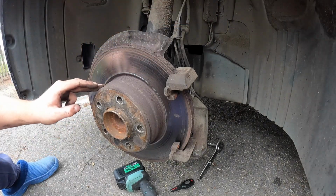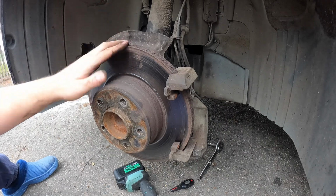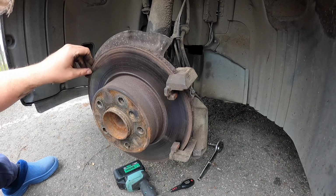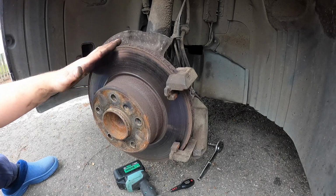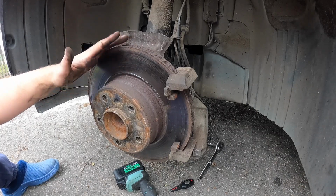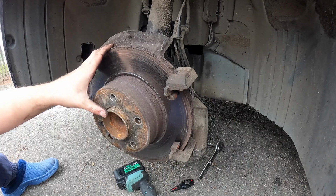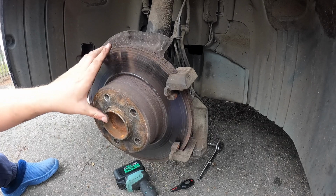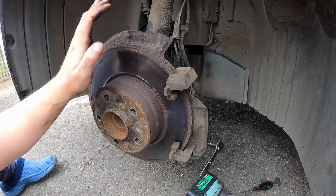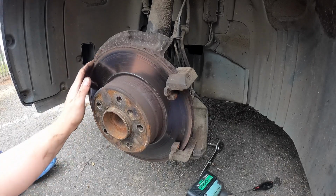Right, I just want to say something in regards to discs. Car parts companies make it so confusing, but essentially the rule of thumb is 520, 525 and 530 have the same size discs, and then the 535D, 540 etc. doesn't. So just don't worry too much. I'll put the specs of the disc in the description below, so if you ever get stuck or need to look, just go on there. That's the general rule of thumb, unless obviously it's a specialist vehicle in some way, i.e. police car or whatever. Just double check then. But if you've got a bog standard 520, 525D, 530D, all the brakes on the front are the same. I'm sure of that. So just to let you guys know, really, put your mind to rest.